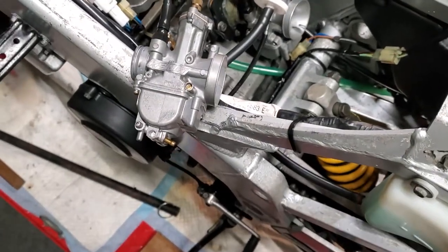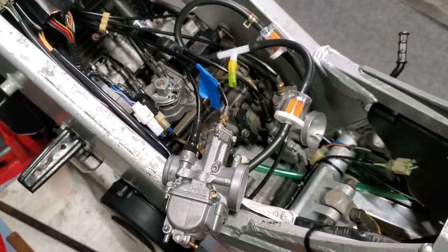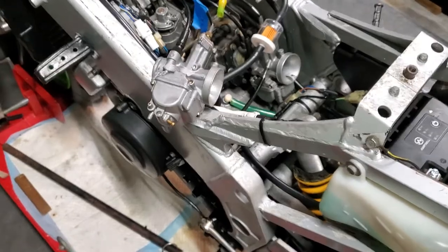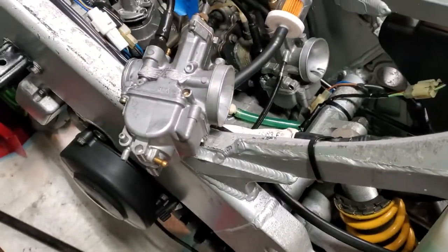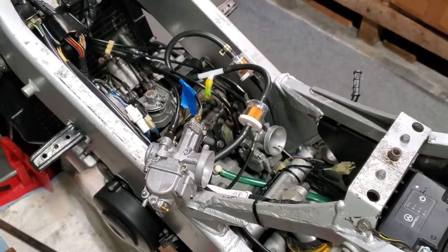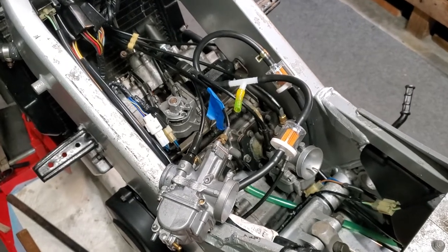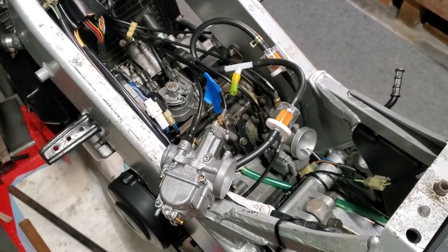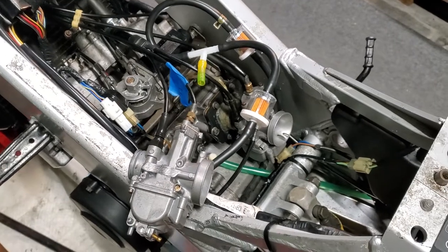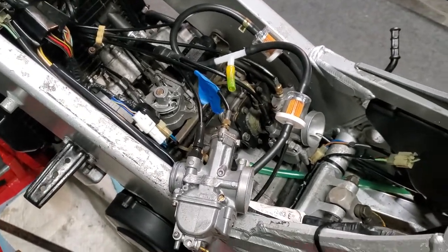I just got it to fire pretty well — it had a little run without the fuel IV bottle hooked up but burned some of the fuel that was in the carb. On starting old bikes that have been sitting five or fifteen years, I find you want to dial the idle up pretty high. Even holding the throttle open doesn't emulate dialing up the idle — it's something different. This one won't start on choke; I'm getting it to start in Florida's warmth with no choke and higher idle.